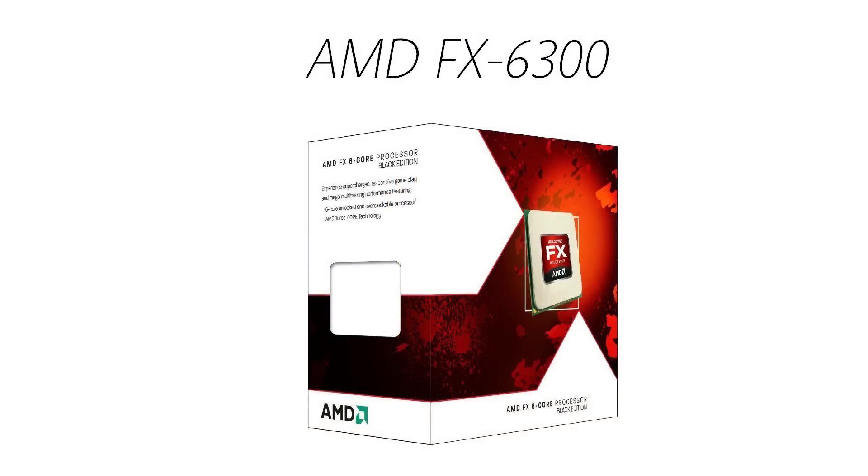For a processor I chose the AMD FX 6300. It's a hexa-core processor, clocked at 3.5GHz, and it's really easy to overclock. More games in the future are actually starting to use extra cores, and if you do any video editing it's also made much faster, so this is a pretty good processor to get started with. The FX 6300 will run you about $100.